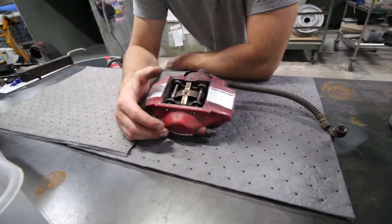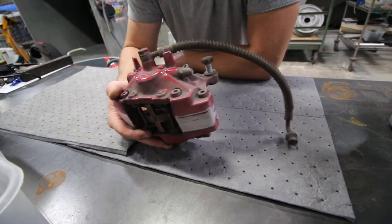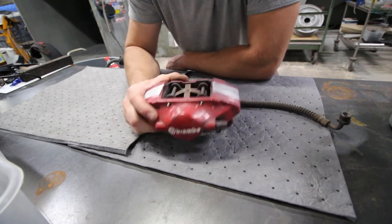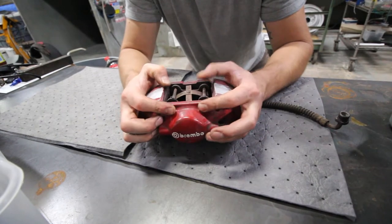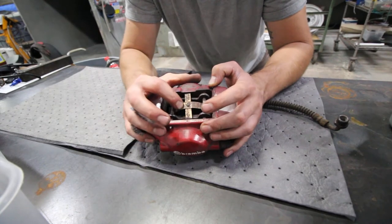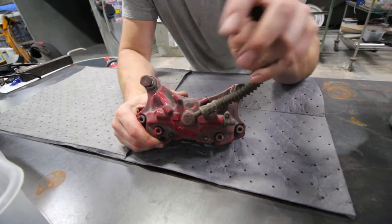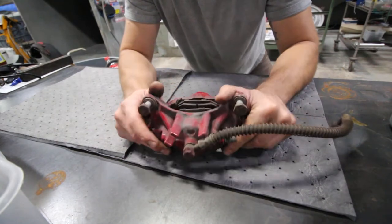Just to run through the process quick, the rear calipers are gonna be a little more messy because obviously they're not remanufactured, renewed. So what we're gonna do with these is, if you have an EVO, or a Brembo style caliper, pop the two little pins out. That's what basically holds the pads in. Take the clip off, and then the pads just slide right out. I'm gonna take off this brake line, which I know Kenny probably already has the stainless ones.